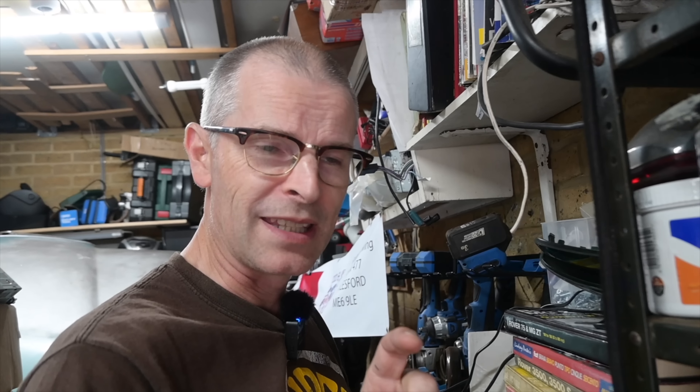Taking the extreme measure of dumping a gallon of V-Power into the tank and leaving it to marinate over the weekend. I've also hit it quite a lot with a hammer and been sparking it backwards and forwards with just raw battery leads on the floor - it does click and clunk each time but doesn't continue to run. However, we do have a big advance: turning the ignition on now produces a little grunt from the fuel pump starting to prime. But it's not continuing - just one little grunt. I think it's clogged up; the fuel in there has just gone nasty and clagged it all up, and because it's not an openable, serviceable item, it's dead.